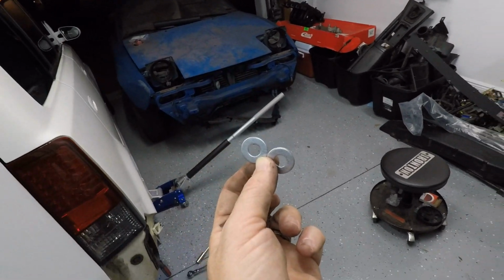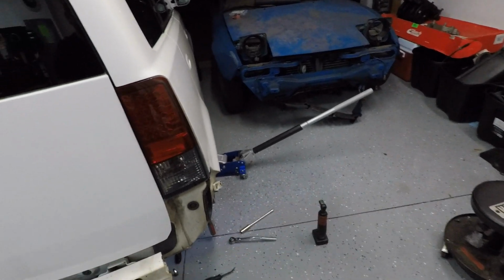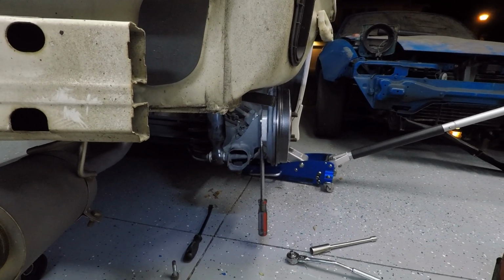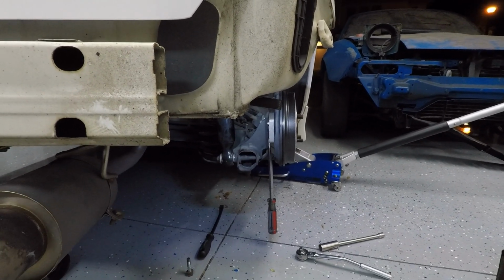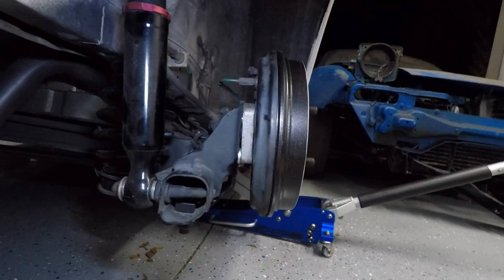Now, if you didn't want to go this route, if you want to install a spacer back there that already has some negative camber, they do sell camber kits for these cars. If you go to realcamber.com, they have a -3 spacer and they have a -5 spacer. Real good guy over there. He'll be happy to help you if you don't want to try this way.